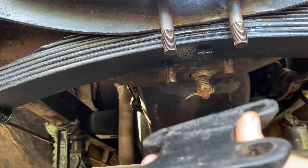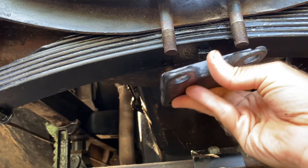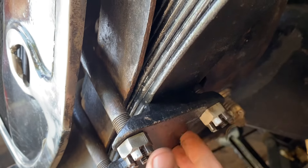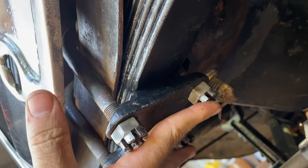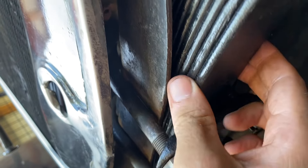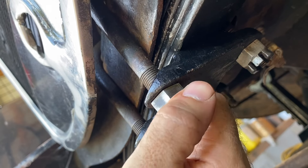Underneath here I'm going to put this plate back on with the hole facing the nut, and line up those four bolts. What I did was push up the plate with one hand and just barely got the four nuts started while bench-pressing it underneath the car. Now I need to slide this leaf and make sure that the top bolt fits into that slot in the crossmember.